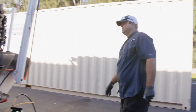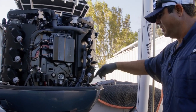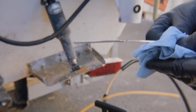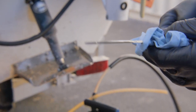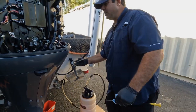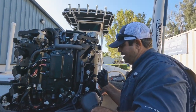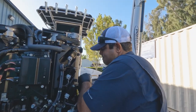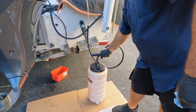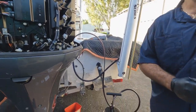Let's start to siphon the oil out. You can buy a small siphoner online. Always visually check the oil — this is probably about 50%, so it's really not that bad. But yearly maintenance is 100 hours or a year, and I'm pretty sure he doesn't have 100 hours this season, so we're going to siphon it out.